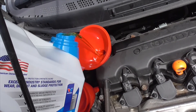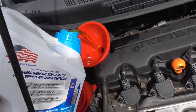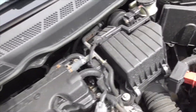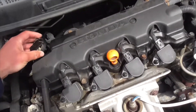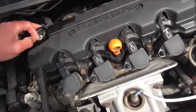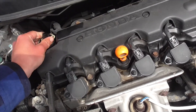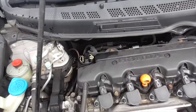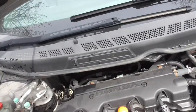Now that you've put your oil in the car and got it to around the recommended amount, take the funnel out and screw the cap back on. You want to do a little less than the full oil capacity — this car's capacity is 3.9 quarts. Have it between the minimum and the capacity. Once done, close the hood.